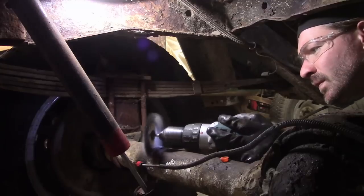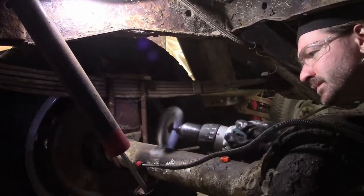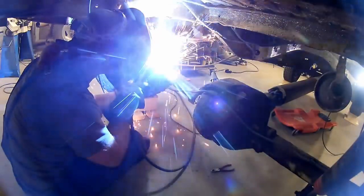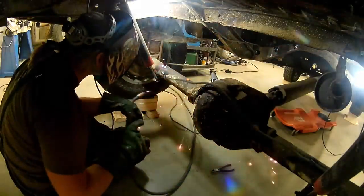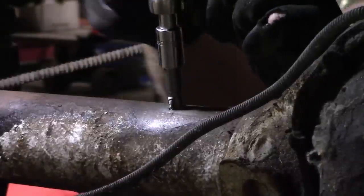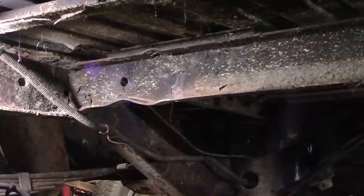Because of this, I'll put a longer vent hose on, and I'm going to weld up the hole for this bolt, and then I'm going to put a stud on instead that I can then guarantee will not cause contamination. I figured I'd better tap some real threads into the vent hole and put a proper fitting in it.